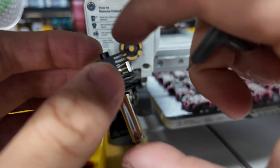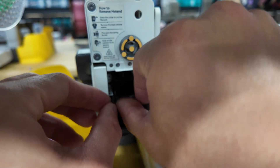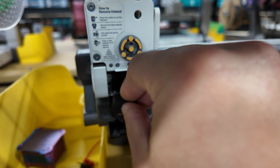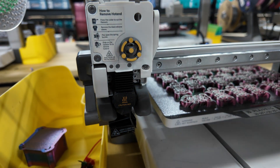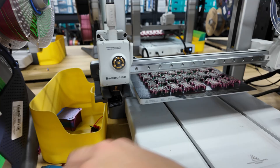You have about 20 seconds to do this. At some point you'll feel that there's basically no plastic left — it's basically frictionless. Once that's done, I just put the nozzle back on and it's pretty much ready to print. That really cleans out the clog for the most part. You want to get the nozzle as hot as possible before doing this — I had it at 220°C. That's the quick and dirty way I do it to unclog the nozzle mid-print.